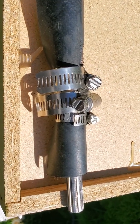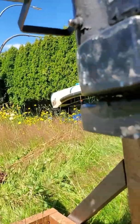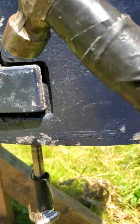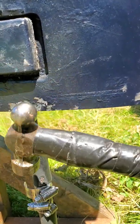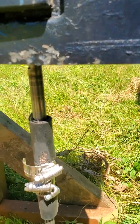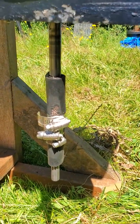This setup I made not only protects where it clamps on but also protects if you're hammering down on these clamps. What I was doing was leaving it in there and hammering down, keeping it as straight as possible so I don't bend the drive shaft — boom boom boom boom — and when you miss a little bit it hits the rubber part and doesn't cause damage. I literally hammered down on this thing for about five full minutes, hammering as hard as I could.